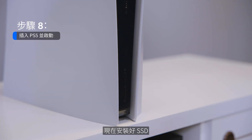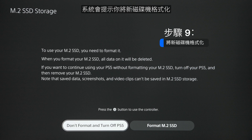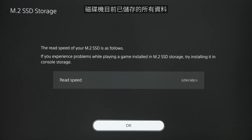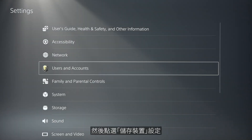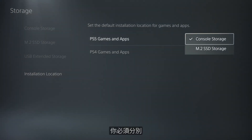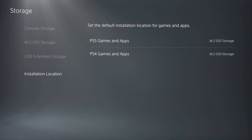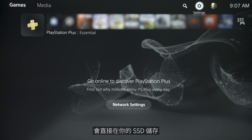Now that you have the SSD installed, you'll plug in the system and power it up. You'll be prompted to format the new drive and you'll want to go ahead and do that. Take note that this will erase any data you currently have stored on the drive. To use the T500 as your primary device you'll want to go to settings, then storage settings, and manually select the T500 as your default download location. You'll need to do this for both your PlayStation 5 and PlayStation 4 games separately.